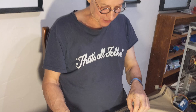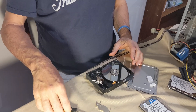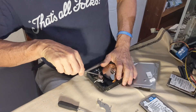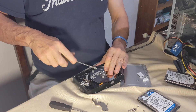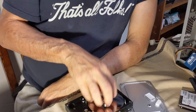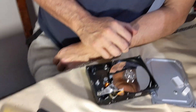I've just realised I didn't show you how to destroy the hard drive — it's actually really, really easy. I've already destroyed the head, so that's the first sign this hard drive's in bad shape. All you really need to do is get a screwdriver and just scratch the upper platter. If there's either a lower platter or the bottom side of the platter, there is no way that the information on that disc is going to be readable. Just run a screwdriver over it a few times and at that point it is absolutely irrecoverable — it cannot be recovered, it's destroyed. So if you've liked this, please like, subscribe and comment. I'll see you next time from Paul in Perth. See ya.